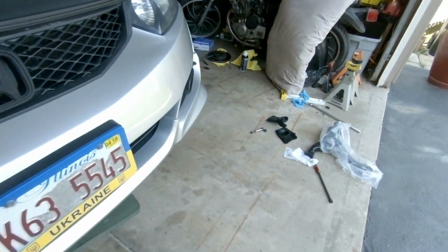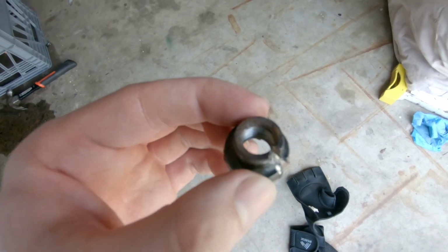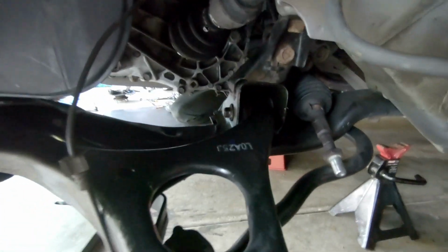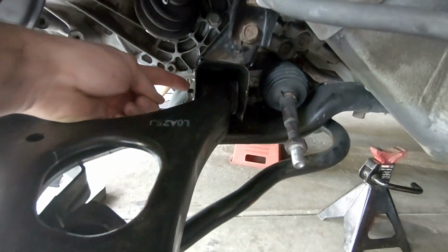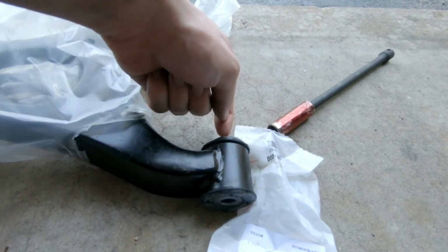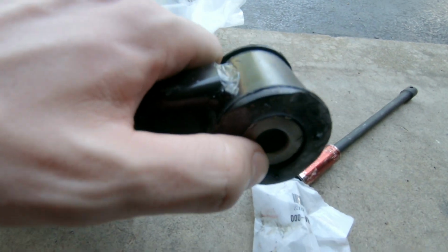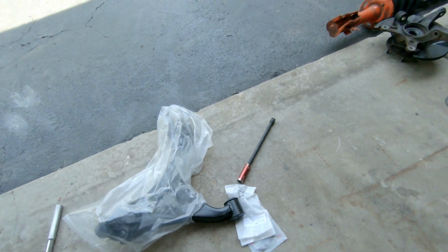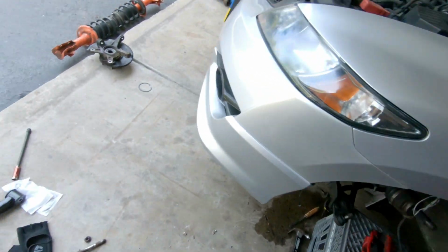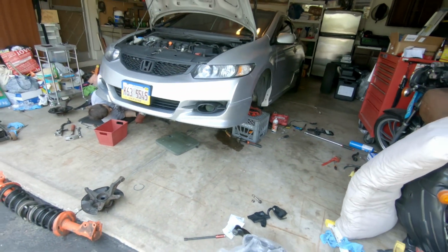The other one, what we ended up doing was we cut the rear of it. We kind of used the Dremel and cut it and then unscrewed it. But we cannot remove that bolt. The bolt is still in the back. And what I think is going on, and I'll demonstrate on the new one, even though we're turning that bolt on the outside over there, I think this whole interior piece is spinning. It's just corroded in there so much that it won't let go. We impacted it like 30 times. We tried penetrating oil, hammering it out, and nothing is working.